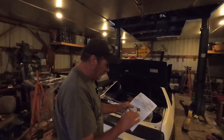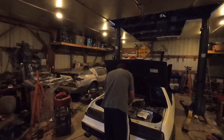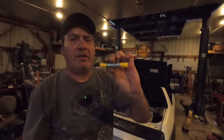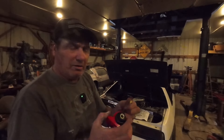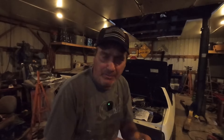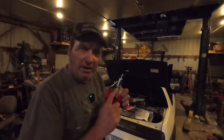Fuel line from tank, fuel line to engine — pretty simple stuff. It gives us all the basics: positive, negative, and you know. What comes in the kit? Fuel pump. I believe this would be a filter — already has one fitting in it. The other fitting is going to screw in here and that's going to go to the fuel tank side. Should just be able to tighten this up. Should probably put some thread tape on this real quick. We already had a mount in here — we're going to use the same mount.